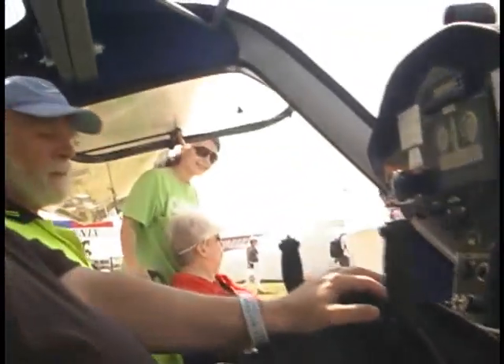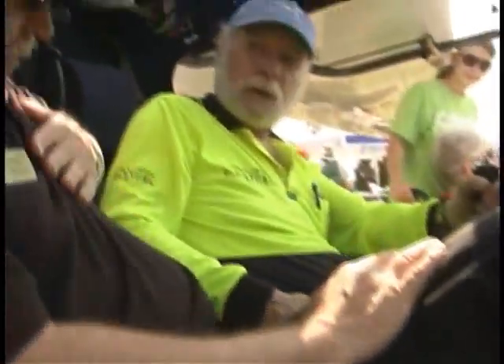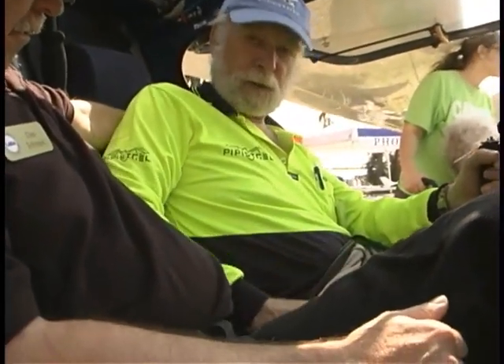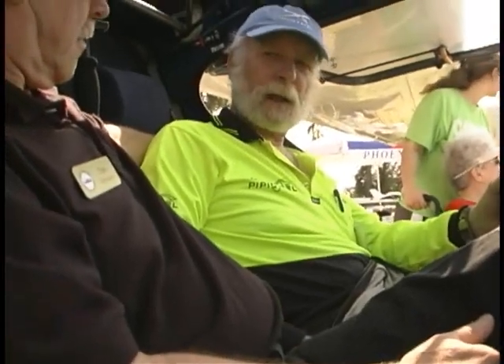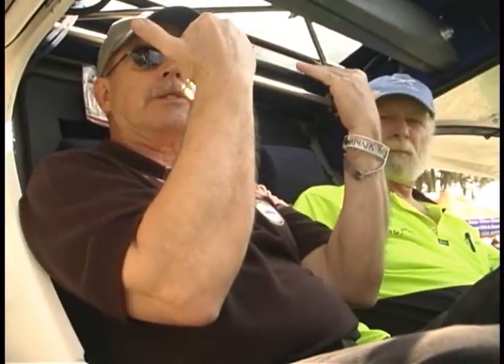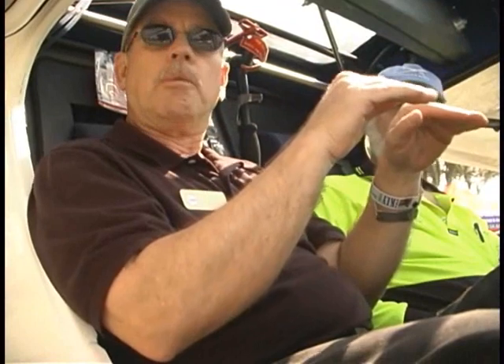Does the airplane have flaps? Yes — it's got flaparons out on the wing with four positions: two, one, zero, and then a negative called the reflex position for soaring pilots, which gives you more efficiency. Reflex brings the back end of the flaps up a little bit — not just to neutral but actually raised — which helps the airplane have a little more speed. It's common on many European airplanes but quite rare on American airplanes.